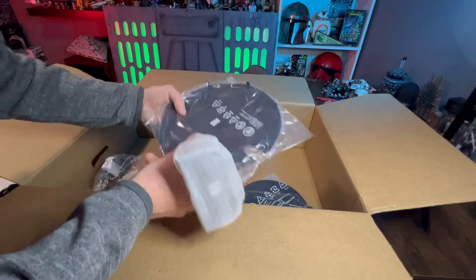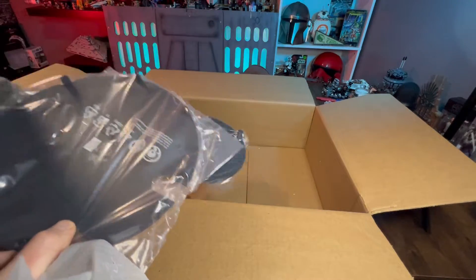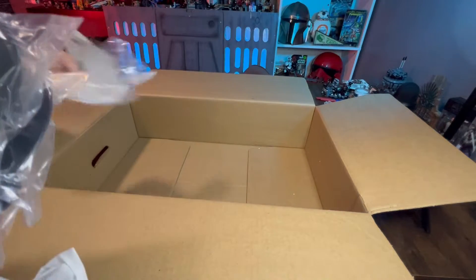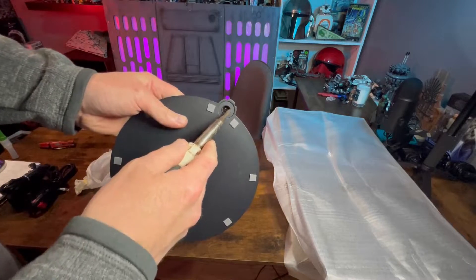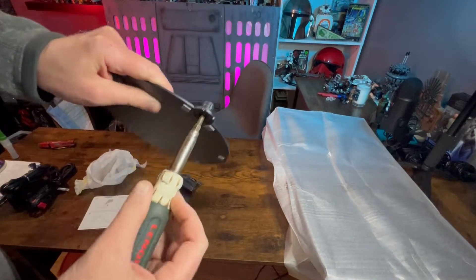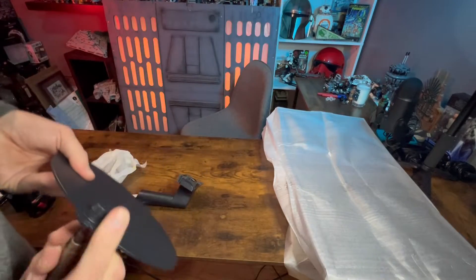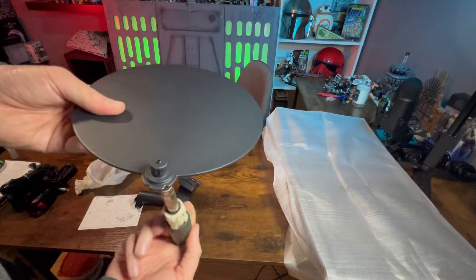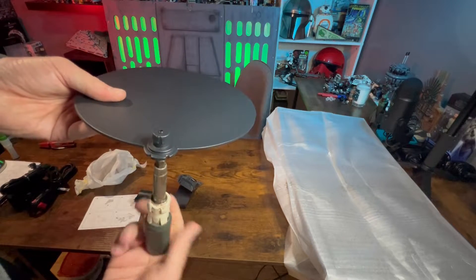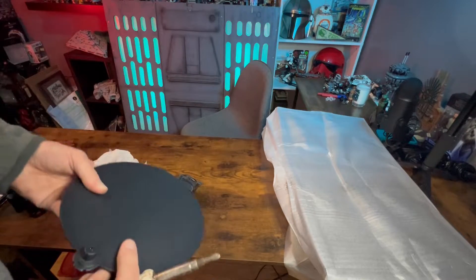You're going to see our stand here for the screen, and that is our back cover, and there is our bottom plate, which is pretty heavy. The bottom plate on our monitor actually has a screw on the bottom of it, and as I'm twisting here, it'll push up the screw. This is more of a compression fitting — when you're tightening up your Phillips head, it's going to pull this stem down, and that is what is going to keep our screen in place on our nice sturdy platform.